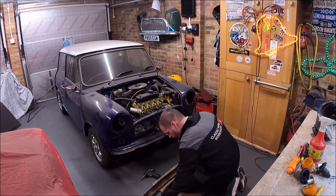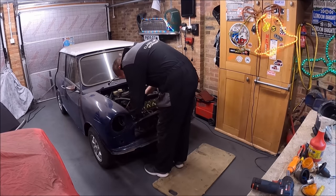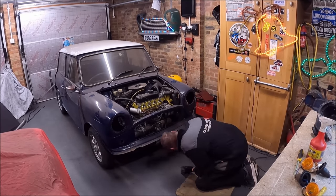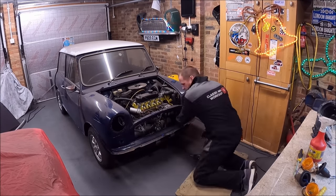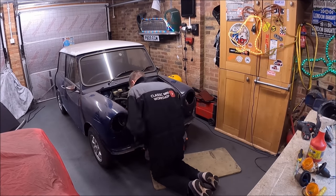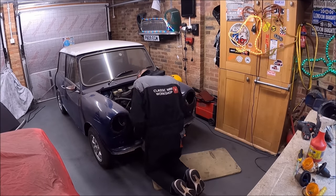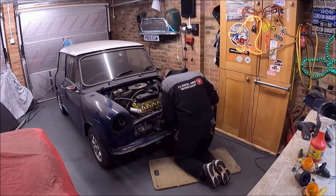So I thought I would just come on and do a quick bit of narration, because I know in the comments a lot of you viewers are replacing front ends as well, and I'm sure you'll be watching this and maybe want a bit of an explanation over how I do it. So the next few videos are going to be me replacing the front end on Project Bruce. As you can see, I've started out by just removing the headlights, indicator, the horn, the front subframe teardrop mounts, and in a moment we'll start cutting the front end off.